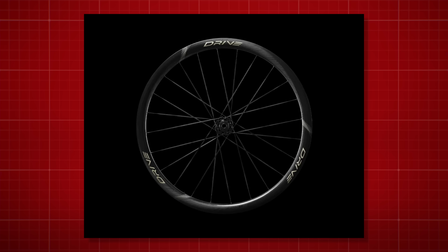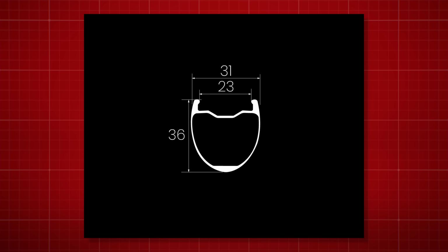Yeah. So as well as that, they've all got ceramic bearings in now. And the previous generation did. Yeah. So they carried that forward, which is cool. They've got 23 mil internal rim. So previously it was a 21. Yeah. Right. So they've made it wider for wide tyres. Wider tyres, 28s, 30s. Nice. Into that. Proper cool that.